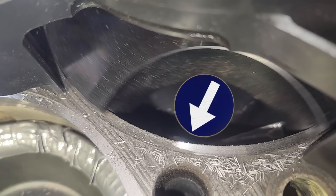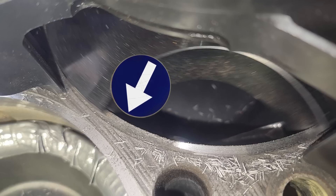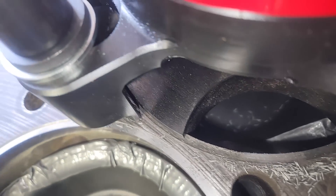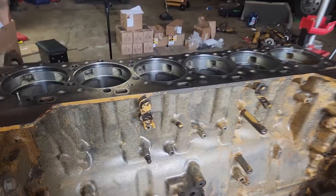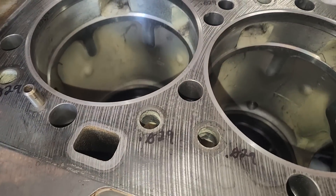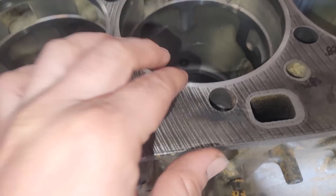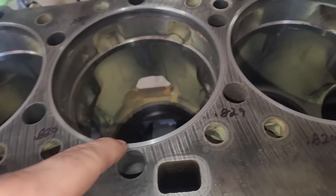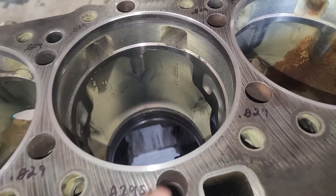Look at this line on number four — you can see the shiny section transition to the dull part. After six thousandths of cut, that worn out section of the block where I showed you before was over six thousandths gone. So the counterbore was really needed on number four. We cut all six — they all cut very well, measuring about 29 to 29.5 thousandths at every single spot. Very happy with the Monaco Tools cutter. They also make cutters for Cummins and apparently other manufacturers as well.